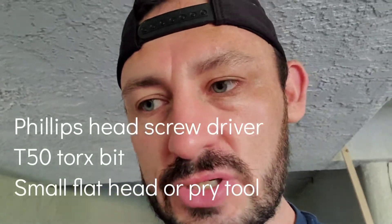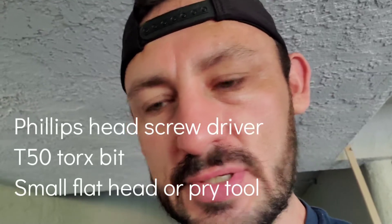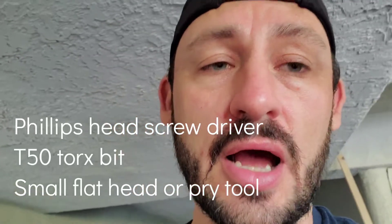This is a temporary thing — we're probably going to put the seat back in. It's really simple. All you really need is a Phillips head screwdriver and a T50 Torx, plus a wrench with an extension. Everything is reachable. There's only one part that's a little bit difficult, and I'll tell you what it is. I already removed my seat so I'm just going to walk you through it and give you a couple of hints on the difficult part without having to remove way more panels than you actually have to.